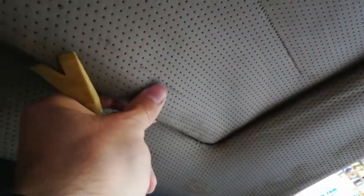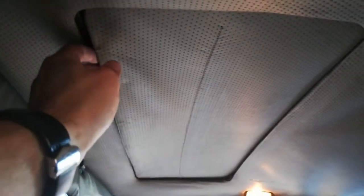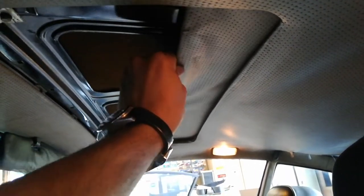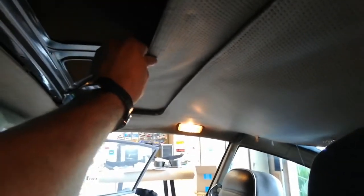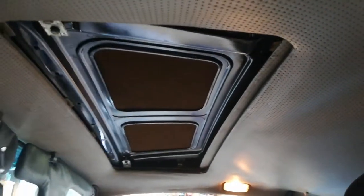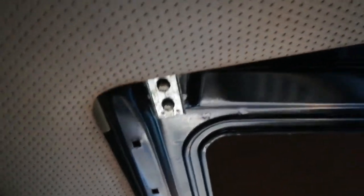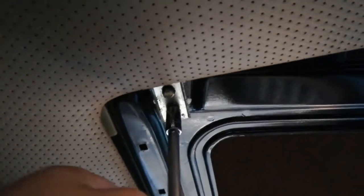If you've successfully exposed the front edge of the sunroof panel, grab a plastic trim tool with a pry bar shape and release the clips at the front edge of the sunroof along the entire length. Then push the panel back as far as you can into the headliner. At the front corners of the sunroof there are two bolts on each side that secure the sunroof panel to two clips — remove all four of these bolts using an 8mm socket; they're really tiny.